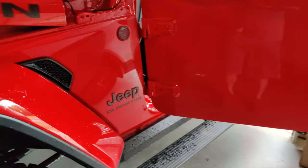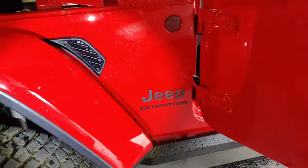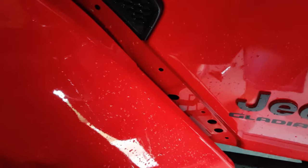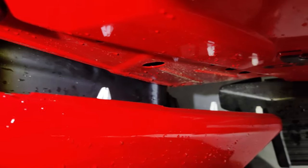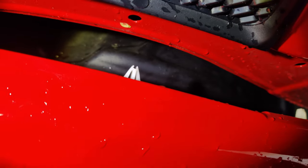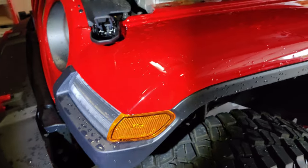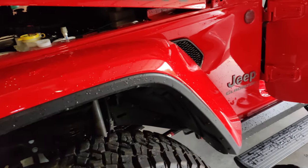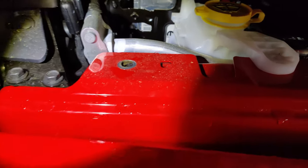Small update — I've decided to mount it right beside the Jeep logo on the fender. These fenders literally just pop off; they're held in by little clips. At first I was trying to compress the clips with needle nose pliers, but after watching countless videos I realized people just yank them out. They're designed to do that — if the fender gets caught on an obstacle it won't rip or bend the metal, it'll just pop the flare off.